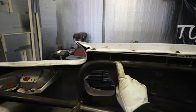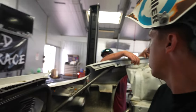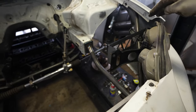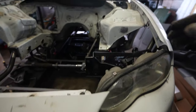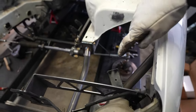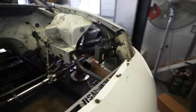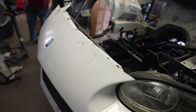Jumped on the inside and tacked it there, there, up there — kind of worked out a solid spot on the inner rail of this laser-cut bracket. Everything looks pretty good, nice and solid. We'll pop the bumper off and I'll finish welding it. Went ahead and bolted this bracket to the back of the factory headlight bracket, got it positioned the way it was from the factory. It does match the 12 inches up that they mention in the instructions. I just need to figure out how to cut these bars that came with the kit, cut them down to fit up along the top of this crossbar, and then this welds right to the backside — and you've got a headlight bracket.